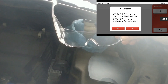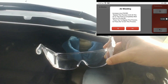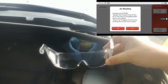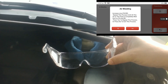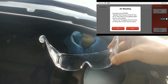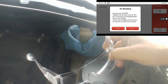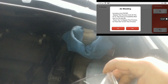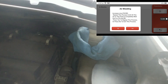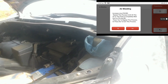Continue to wear your safety goggles and do not touch the paint as you're handling brake fluid. Once you get to the right rear tire, you are done with this sequence. You can go ahead and repeat this process as many times as you like on any side. For example, if the front passenger side brake line broke and that's where most of the air bubbles were, you can focus 90% of your efforts on that and just repeat this process once or twice on the other lines to make sure you are really air-free. The scan tool makes it really easy — hit yes and it will keep activating the pump for four seconds.